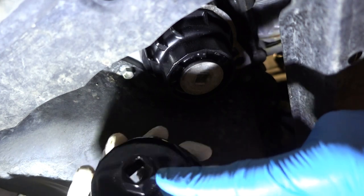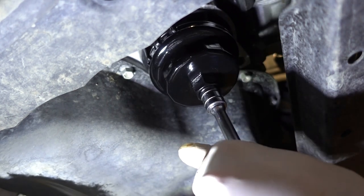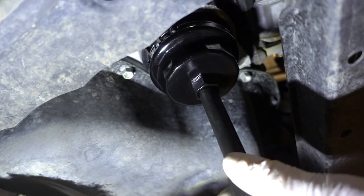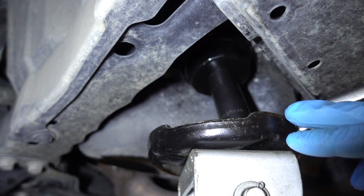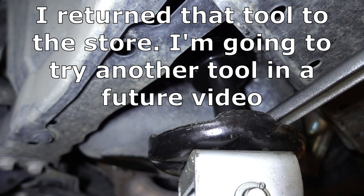This oil housing tool takes a one-half inch drive. That's on tight. I just cracked the ribs on the oil filter housing — this might be a bad day. I finally got it to turn, but to keep the wrench from slipping off, I used my floor jack to put a little bit of pressure on the tool so it wouldn't slip off of the housing. What a hassle.